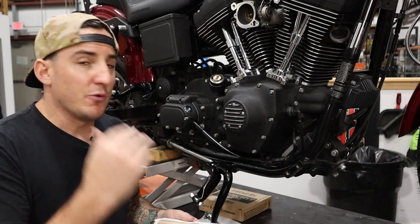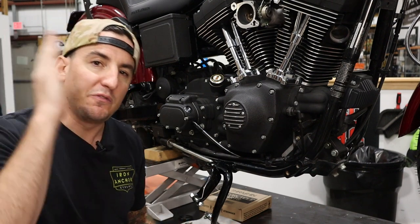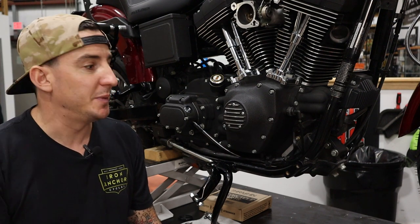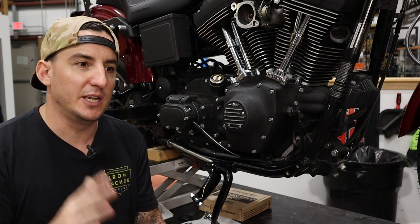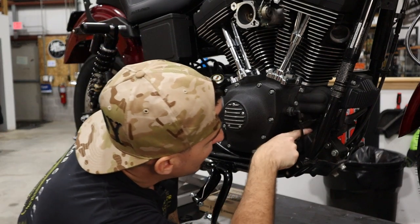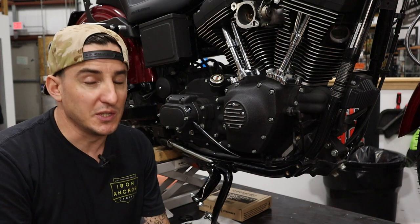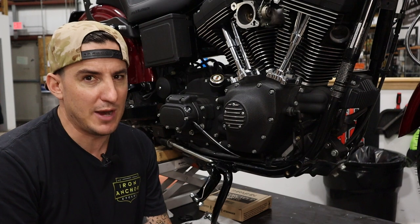So when you're wheeling a Dyna, particularly if you're learning, the likelihood of perhaps putting the front end down harder than you planned on is definitely a realistic possibility. And one of the known break points on these bikes is with that repeated impact to the front end, these front motor mounts here have a tendency to break, which is obviously an incredibly expensive fix. And you gotta find somebody who could actually do it and do it properly.